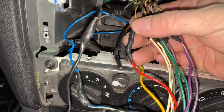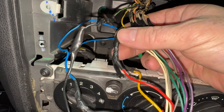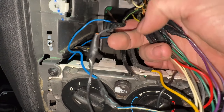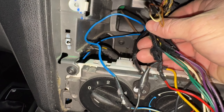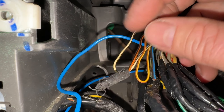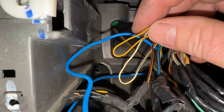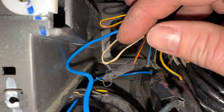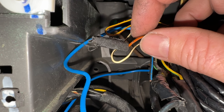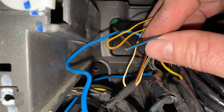The accessory switch is connected to red on the old unit. It's worth noting they can be swapped around depending on the manufacturer — if you buy a kit they come with bullet lugs to swap them around. Then this is the negative over this side. There are another four cables here — brown/yellow and white/black I believe are going to be for the steering wheel controls. Orange/black is typically for dimming lights: when you turn your headlights or parkers on, this becomes live and dims the stereo lights. Then there's another one which would probably be for the power antenna.